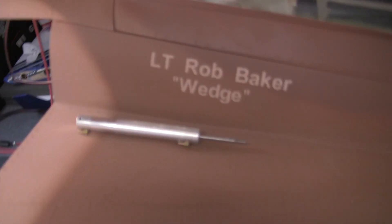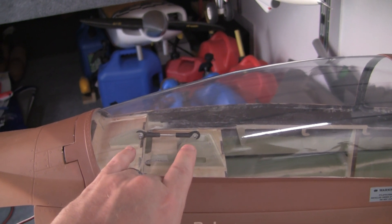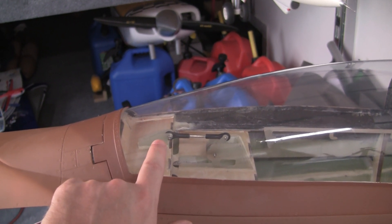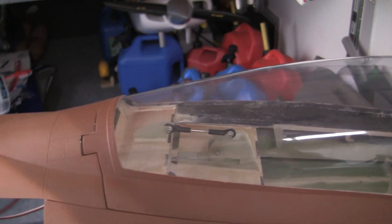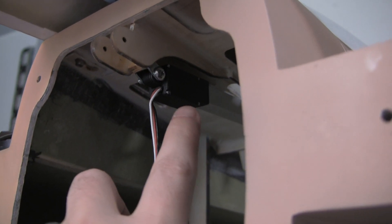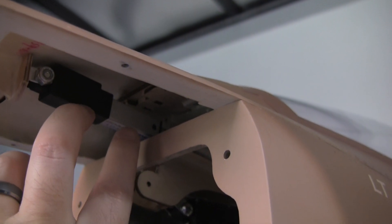You could make their system work because of that. The problem you run into is the lock. You've got this link, two arms — one connected to the open cylinder, and one connected to your unlock. This portion is connected to your lock or open and close. I've converted all mine — I took out the air and I'm converting to these Actronix linear actuators that I sell. There's a 30mm and a 50mm actuator.